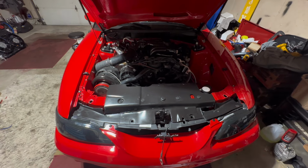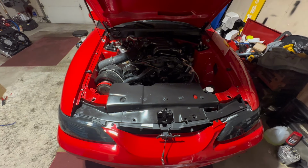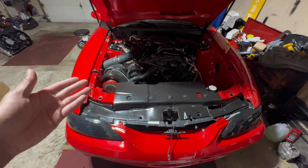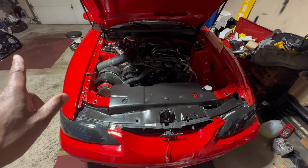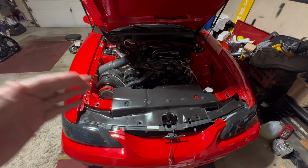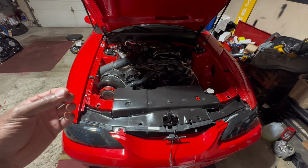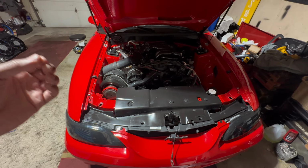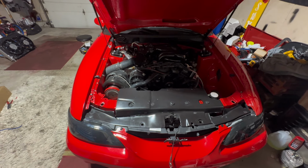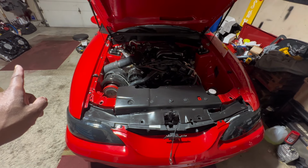Pretty straightforward. So I'm really not going to record the basic part of this installation. The stuff I will record is more of the electrical wiring, because the great thing about using this brushless fan is it's a soft start. So you won't have this huge inrush of current when the fans kick on, when the CCRM commands it, like with the Mark 8 fans. I think some of them, that fan can draw up to a 60 amp surge of current. It could possibly blow a fuse, but with this setup, it's a soft start.